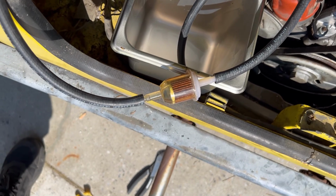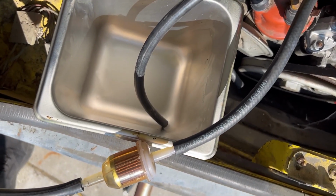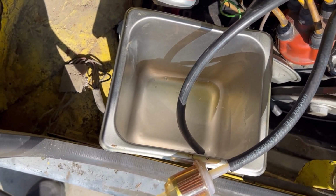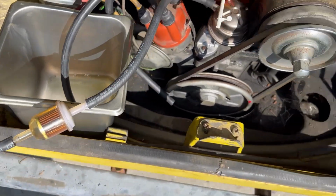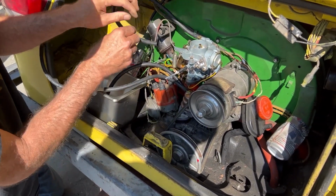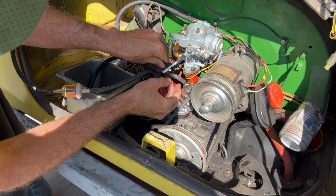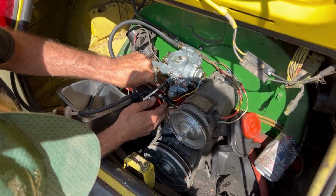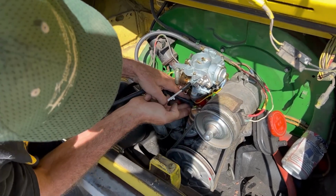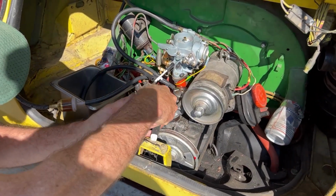Is it not wanting to start? The click is happening. It's not going to the next step. Now it's got gas into the bin. Yay! And it spurts out one shot per pump cycle. Okay. Let's reconnect this. And I think you may still have a siphon on that line. Well, the pump should have a check valve, so gas just won't keep flowing. So these pumps must need gas in them to work. Yeah, or you got to force gas or start a siphon into them, because that's a brand new pump.